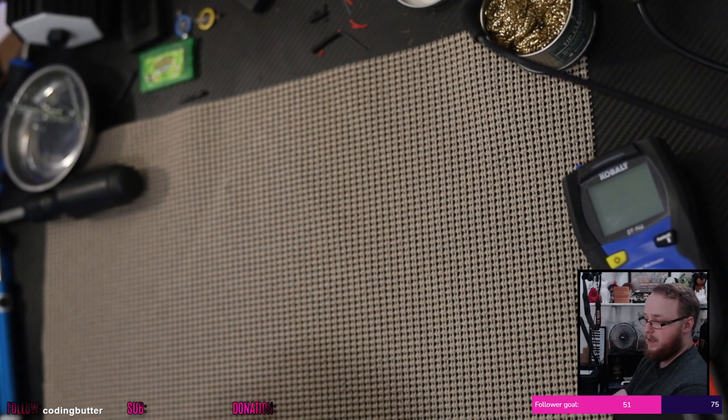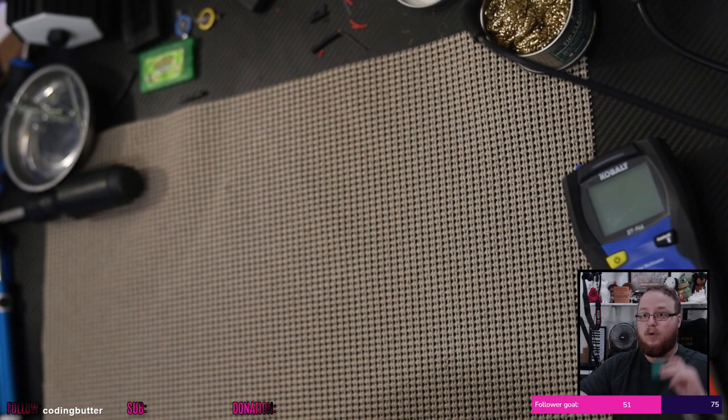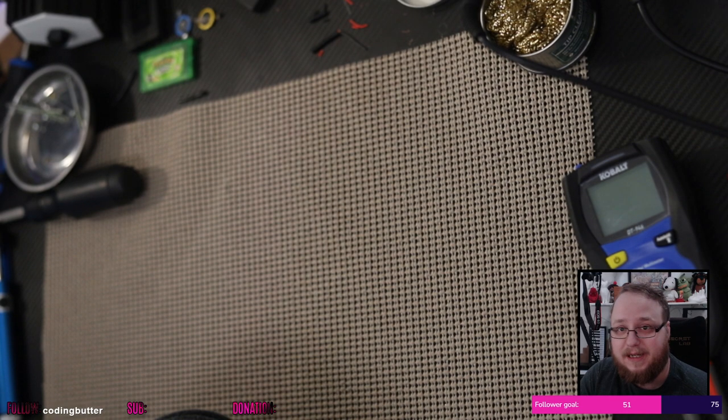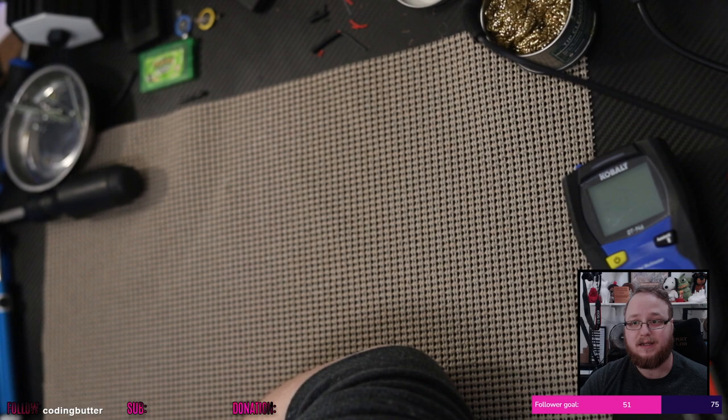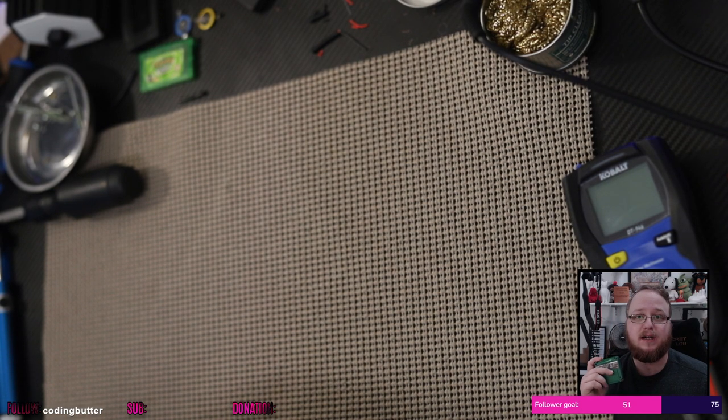Well, guys. Now, if you guys are looking at this as a tutorial, you will need a Nintendo DS, either a DS Lite or original DS, one of them with the Game Boy slot, because you will need, as well, one of the DS SD card readers, or you need the GBA flash version, which is harder to come by. But if you're looking to restore an old save, just remember that you need to reset the RTC, the real-time clock. And if you're trying to start a new game, you're good, you can end here. But if you're trying to restore an old save, then you need to...